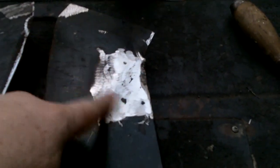Alright, starting to lose my daylight, so I'm going to call it quits for today. This one seems completely sealed up. Took the flap disc to it, cleaned up a little bit, checked for see-through spots. This one's a little bit uglier, but it's because it's a little harder to get the metal to lay down flat. I could add a few more beads of weld in there to add the metal and smooth it off if I was really looking for a show truck.